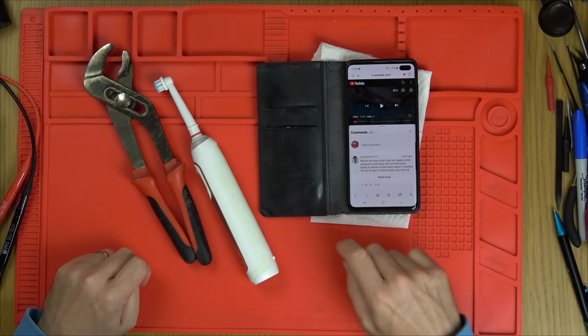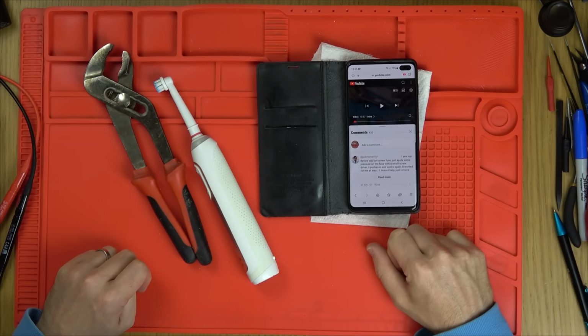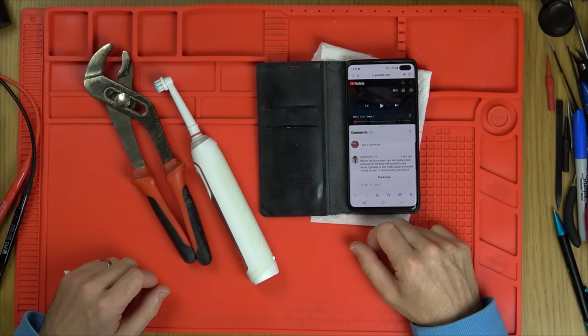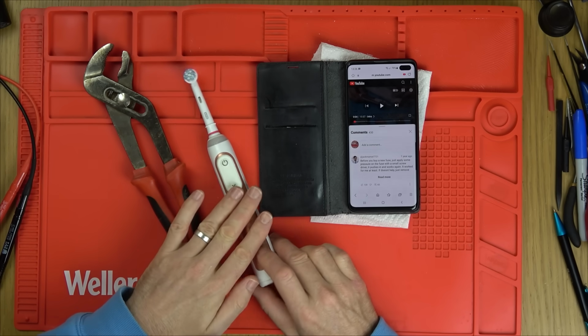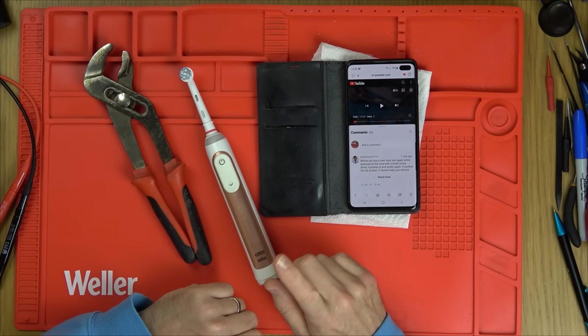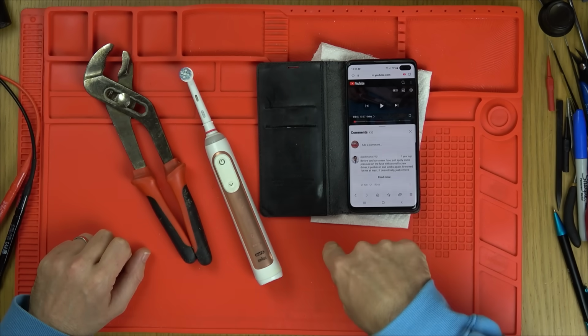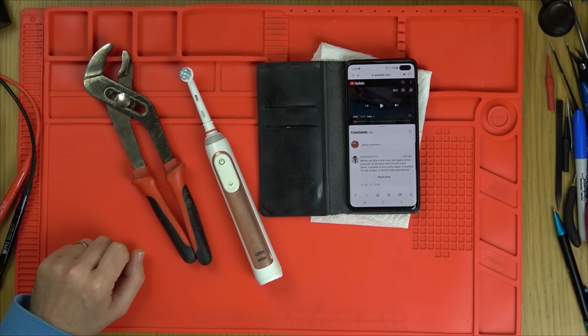So clearly pressing down on the resettable fuse in there is actually manually kind of resetting it, so they must be breaking down. So this looks like it will probably need a new fuse, so I will have to order one up. But for the time being, because my wife wants this working now, let's see if we can get it working by pressing down on the PP resettable fuse in there. One last time.